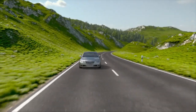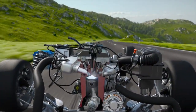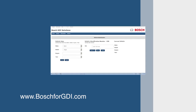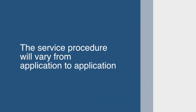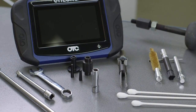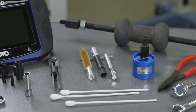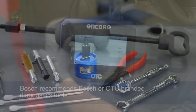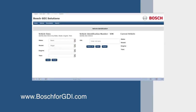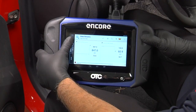Bosch has compiled a step-by-step diagnostic repair and replacement procedure for each Bosch gasoline direct injection, or GDI, service application, which you can view on the Bosch GDI solutions website at bosch4gdi.com. Note that the service procedure will vary from application to application. The tools you'll need to replace your GDI injectors include a scan tool, a seal sizer kit, a fuel injector puller, an injector bore cleaning brush, and an impact hammer. Bosch recommends Bosch or OTC branded diagnostic tools.